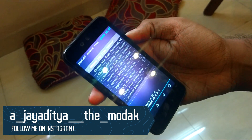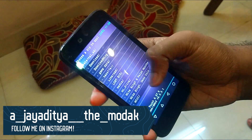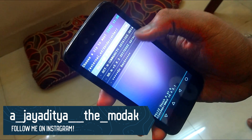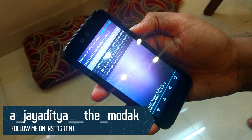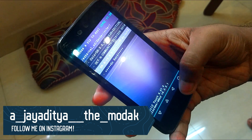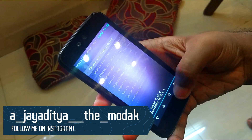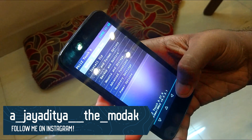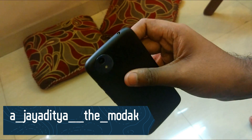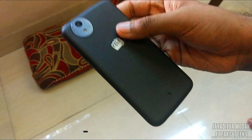Once done, go to Install ZIP — in TWRP go to Install — and choose wherever you stored the downloaded ROM and GApps package. We're flashing Resurrection Remix 5.8.3 for Sprout 4 — don't worry, this works on both Sprout 4 and Sprout 8. Select it, flash it, then flash the Google Apps package as well (links in the description). After that, just hit Reboot System — same process for both PhilzTouch and TWRP.